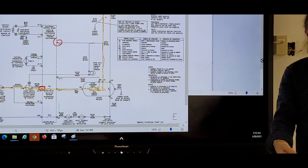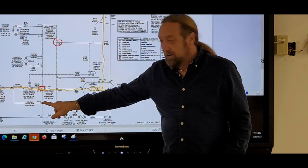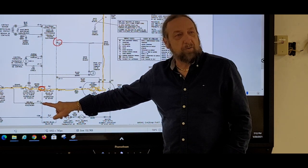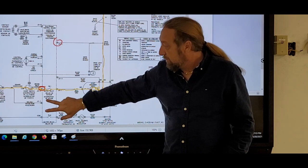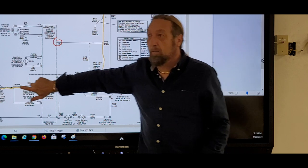What's back before the door switch, after the fuse. 2-1. Okay. You go 2-1, like Chris said. You move the meter lead from here to here, and we know we have voltage here because the board lights up. But you could also put your meter lead here and here for ohms and ohm out the door switch, couldn't